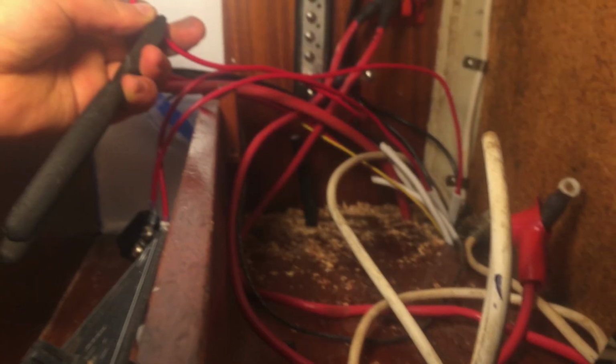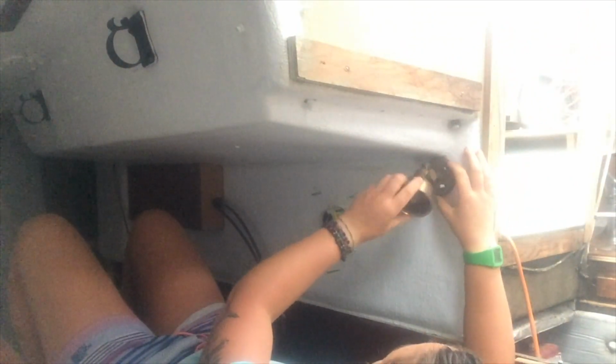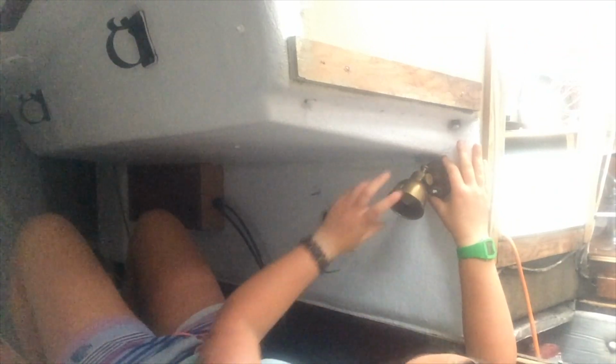Once all the wires were pulled, I led them all back to the same spot where I put a bus terminal in. They all pulled out from the little area underneath where the bus terminal was, and all the ends had to get spliced onto bigger wires because a lot of the ones I was using were leftovers from before. This part, also super fun, also not at all hard, and one of the pleasures I think for me was just the fact that I was able to do it and succeed at something that I never thought that I'd be able to succeed at before. Once all the major wire runs were set up, the fun part came, which was figuring out where I wanted to put cabin lights and fans, and ooh, what a fun thing to design for your little home.